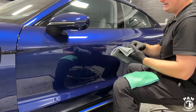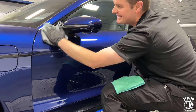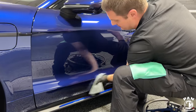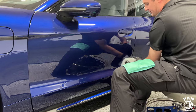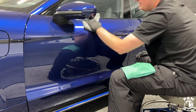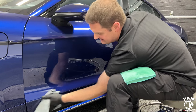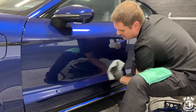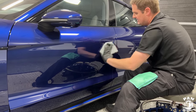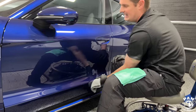The second clean and dry towel — this feels super slick. The entire car was wrapped in PPF: headlights, tail lights, mirrors, roof, doors, trunk — basically every painted surface. We'll go over the entire vehicle with the first coat, which should take about 45 minutes to an hour. Then apply the second layer, because G-Technic recommends two coats for maximum performance and durability. G-Technic says three coats is too much with no additional benefit. Two layers should get you roughly one to two years of real-world protection.